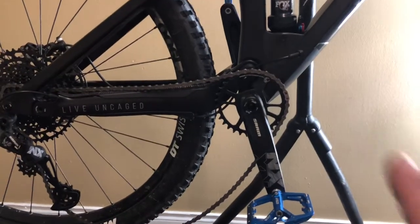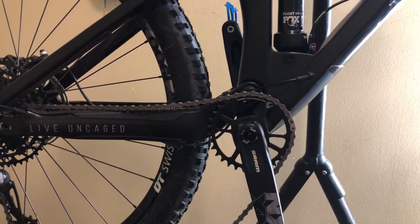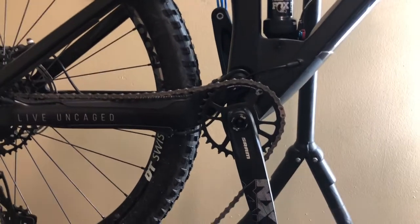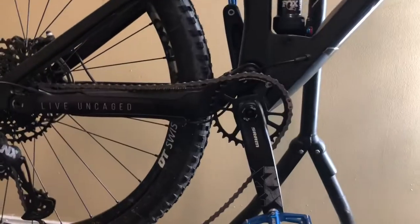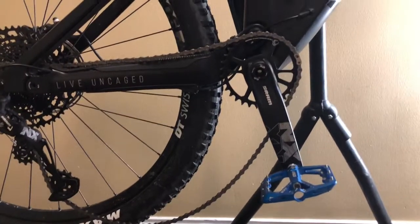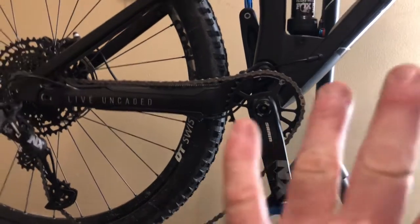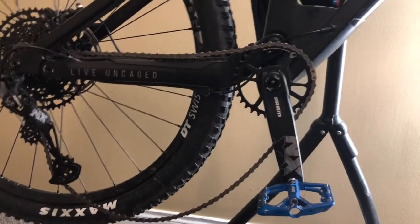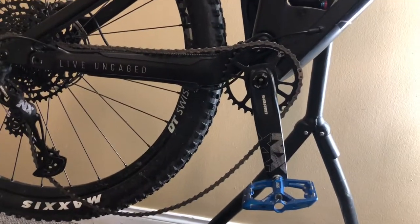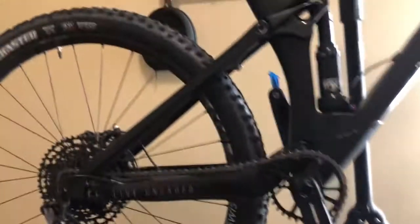Hopefully that helped and made a little sense. For those wanting to change their chainrings on their mountain bikes, it's going to cost about $120 for the new chainring, maybe a little more with tax, and it'll come in next week. I may have to take out a link or two to compensate for the longer chain from the 32-tooth, since I'm losing four teeth on the front chainring.